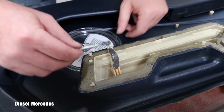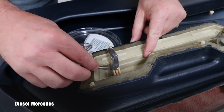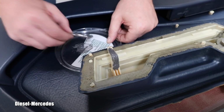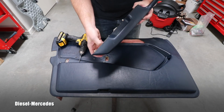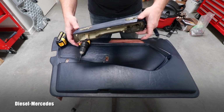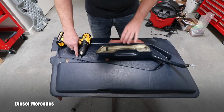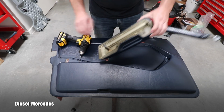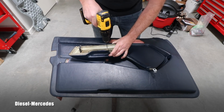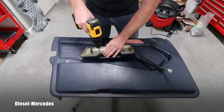And we will see in the future if it can withstand so much pressure. Obviously right now it needs to dry overnight or ideally 24 hours. Now I have 2 layers of this strong glue on that hook, but I would also like to attach this handle to the door panel. That will make the whole thing stronger. There are these holes from broken off parts, so I will pre-drill areas which are selected, and I will be able to put the screws from the other side.